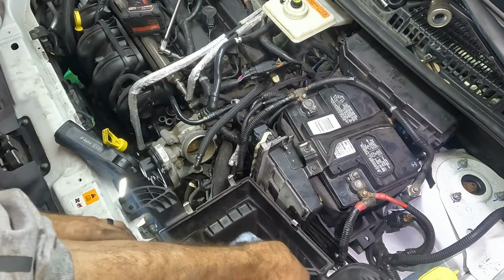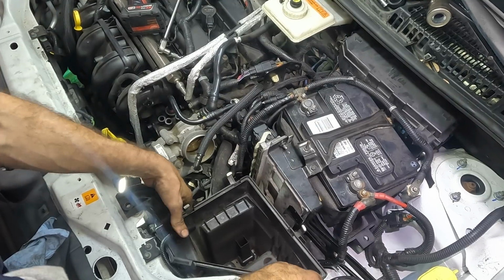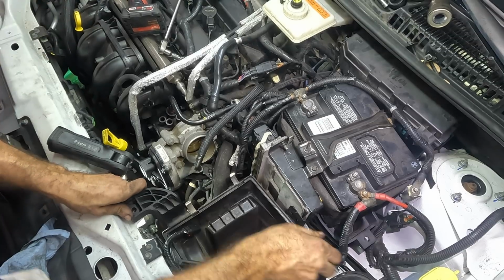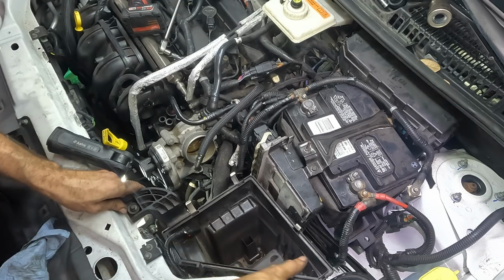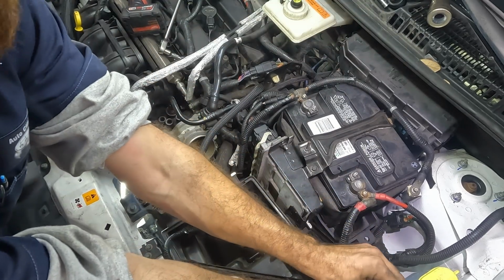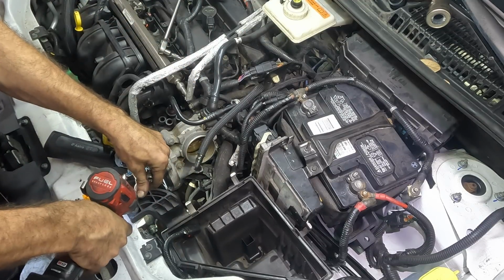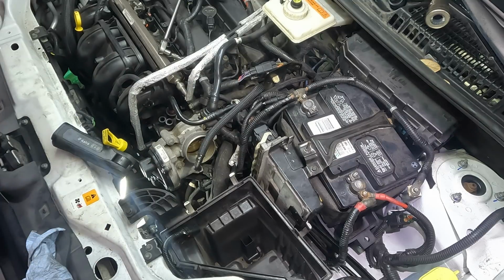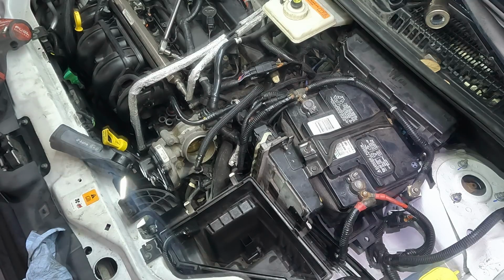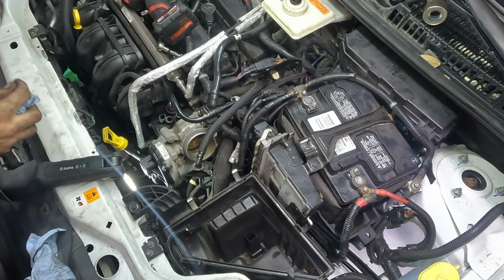Okay, airbox coming in. It's gonna slide down. It's got 2 grommets, and those are pressed in, I think. No, I missed one. I think I missed one, hang on. Nope, we're good. It is aligned. And then 2 long 8mm bolts. Nope, wrong way. 1, 2. All right, those are in.